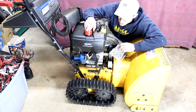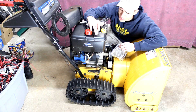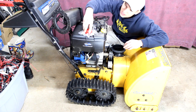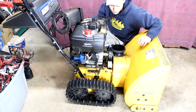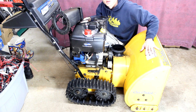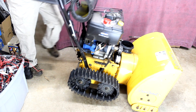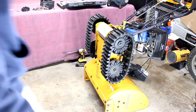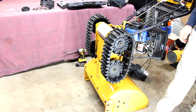So the next thing we have to do is actually tip the snowblower upside down and remove six bolts from underneath. You can either drain the gas out of the tank, or another thing you can do is take a plastic bag, put it under the gas cap, and screw it tight. This way no gas is going to leak out when we tip this over. Now we're going to tip it over — be cautious because this is going to flop around a little bit. Make sure you don't see any gas leaking — you don't want a garage full of gas. Nothing's leaking, so we can move forward.